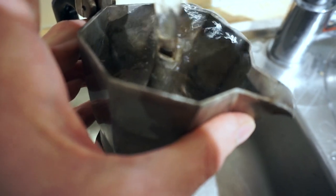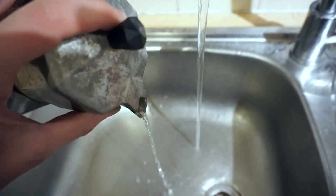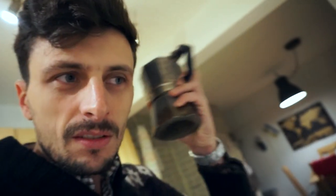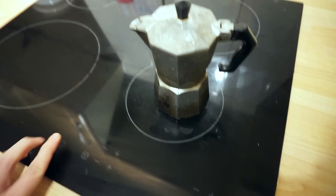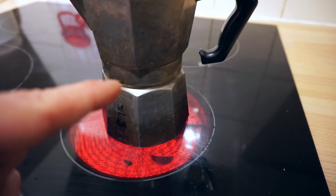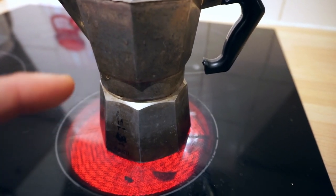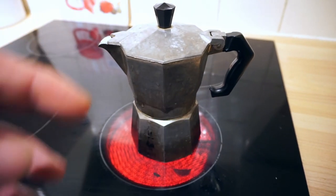So it should be enough — we pour out the excess, check that there is water inside (we can hear it), and then what we do is we boil the water. What is going to happen now is that the heat and the vapor will soften the seal that is in between the two parts, and then it will be easier to unscrew the top part from the bottom.